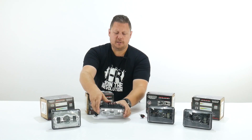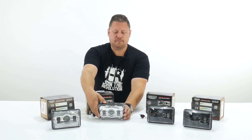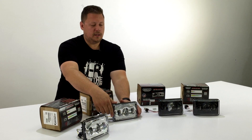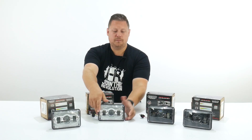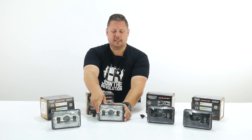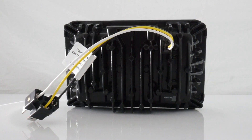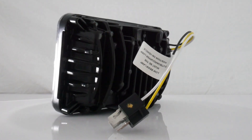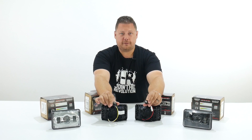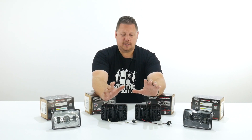On the top of the lens you can see printed standard specification and manufacturing numbers. On either side of the projector, embossed right into the polycarbonate lens, you have DOT, and in the bottom corner it says 'Speaker,' the JW Speaker logo. In the top corner, embossed onto the inner plastic bezel, it says DOT and SAE. On the back you've got black painted metal aluminum heat sinks and H4 connectors for easy plug-and-play install on your existing sealed beam wire harness — no modification required.